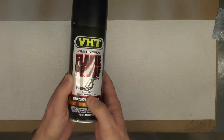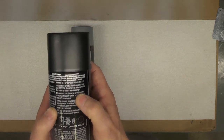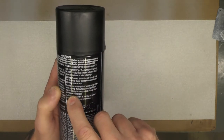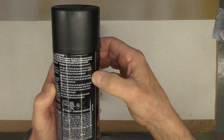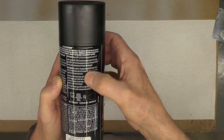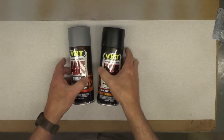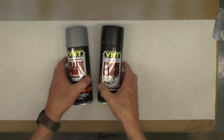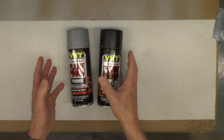It's really like a header paint. When they say on-vehicle, what they mean is you run the vehicle — run it at idle for 10 minutes, then cool for 20 minutes, then run under normal conditions for 30 minutes and let cool. Well, for restoration projects I don't run my projects long enough to do that effectively. You'd have to really ride them and take them out under normal conditions, and that's not really going to work for me on this project.